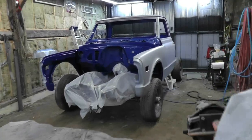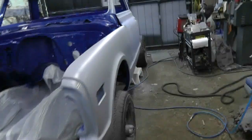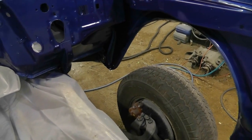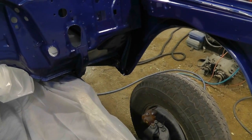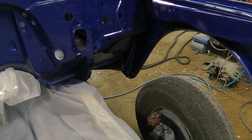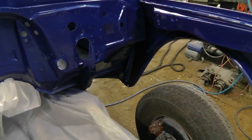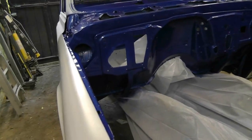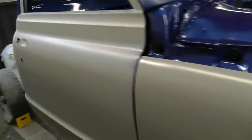Okay, getting there — starting to look more like a truck. I got the fenders on, didn't bang them up too much. These are not on permanently. The gap is consistent, it's just rather wide. I'm going to have some problems I didn't notice in fitting them. There's a bolt at the base of the fender on either side and both seem to be sitting back too far for these fenders to work. Either the rocker, when I put new rockers in, is sitting too far forward or not. In any case, I'll end up just enlarging that hole — same problem on both sides. It may be something as simple as leveling the frame; I'll straighten that out when I do the final fit-up.